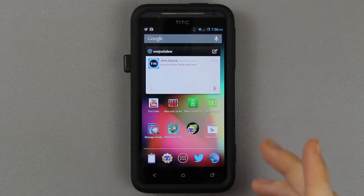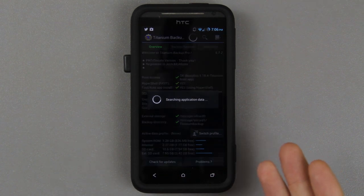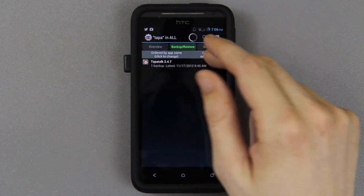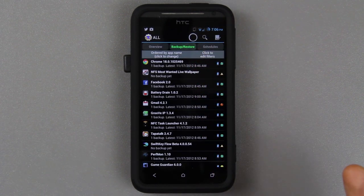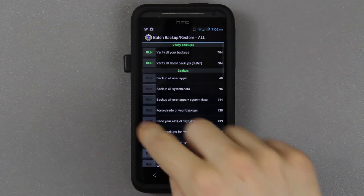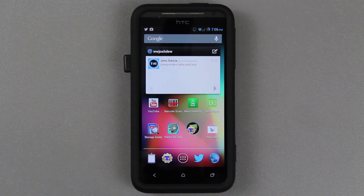Let's just flash this already. First thing you want to do is backup your stuff with Titanium Backup. Open up Titanium Backup. If you're like me and you backed up or restored something, just go here, click Edit Filters, then Clear, then checkbox. Press it and wait till it stops spinning — it's just going through and making sure everything is there, going through all your apps. Once it's done, hit the checkbox and hit Backup. It'll take some time depending on how many apps you have installed.